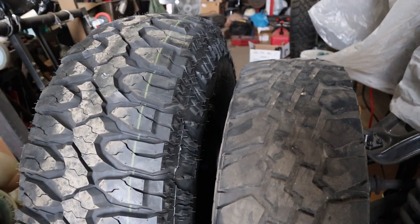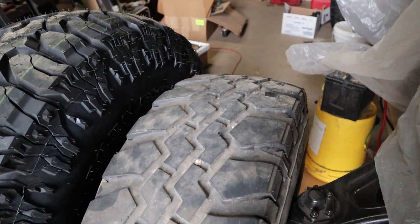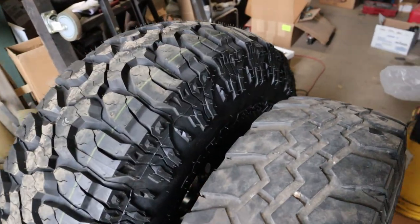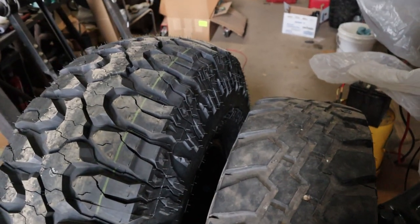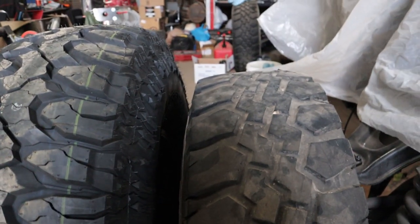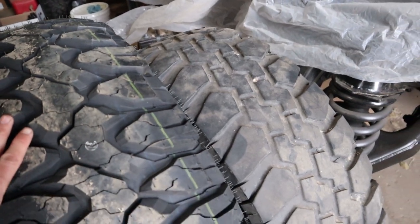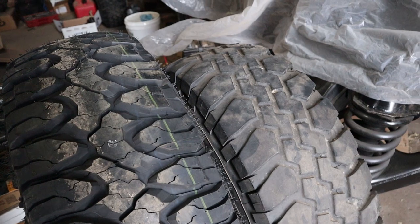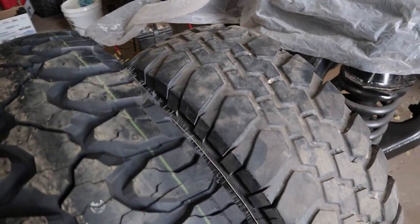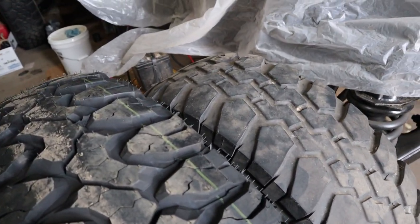Comparing new to old - the old tires on here were 37s but they're worn quite a bit, probably closer to 35s, and the new ones are 40s with no load on them yet, so you'll probably lose maybe an inch there. The gap will be a little less than it looks, but it'll be close. One of the main reasons we can use 40s is because with the three inch body lift going in, we should have no clearance issues. I've seen people run 40s without the body lift but they do have to do some clearancing on the hood and around the wheel wells.